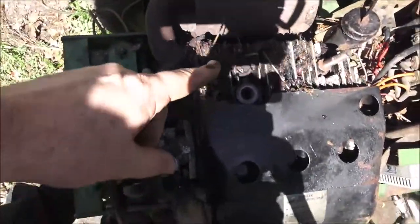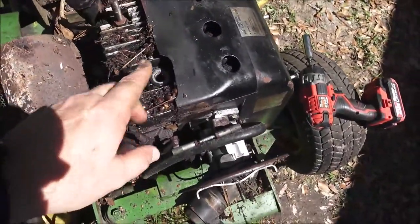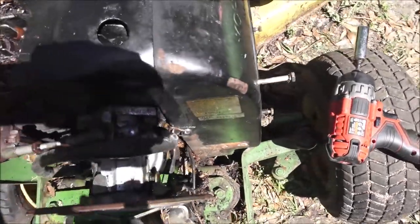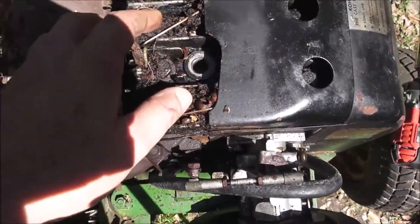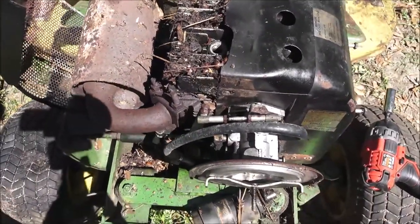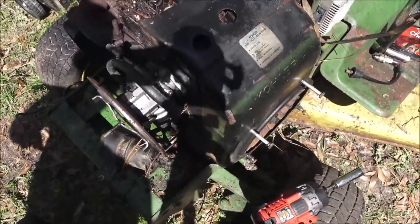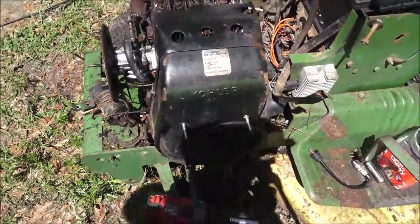This is what I was talking about yesterday — if these aren't cleaned out, these are air fins. There are fins on that flywheel, and what it does is blow air up through here and across the head and over to the exhaust. If those get clogged it's not going to get the air it needs and it'll overheat on you. And same way, if you run without these covers, they will heat up and get hot and cause some major damage to your engine.